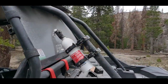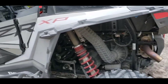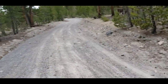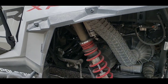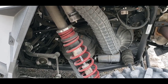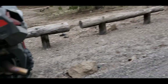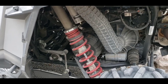Got a fire extinguisher — got to have one of them. One thing I gotta say: even for these pretty well-maintained gravel roads, the tender springs absolutely suck. I'm going to be picking up a set, probably from Shock Therapy, in the coming weeks. For the high-speed bumps it just doesn't do anything — it's garbage, it really jars your teeth, and I can't wait to get rid of them. That's gonna be the next thing I do.